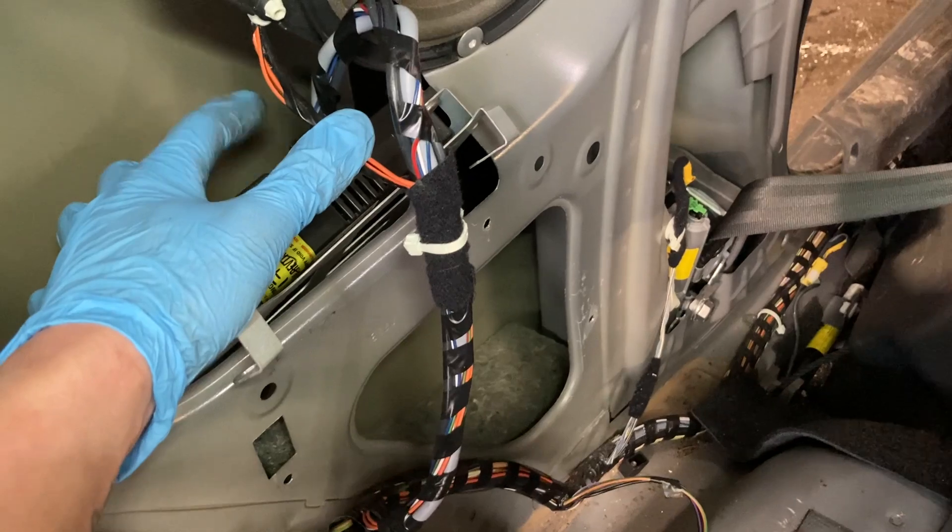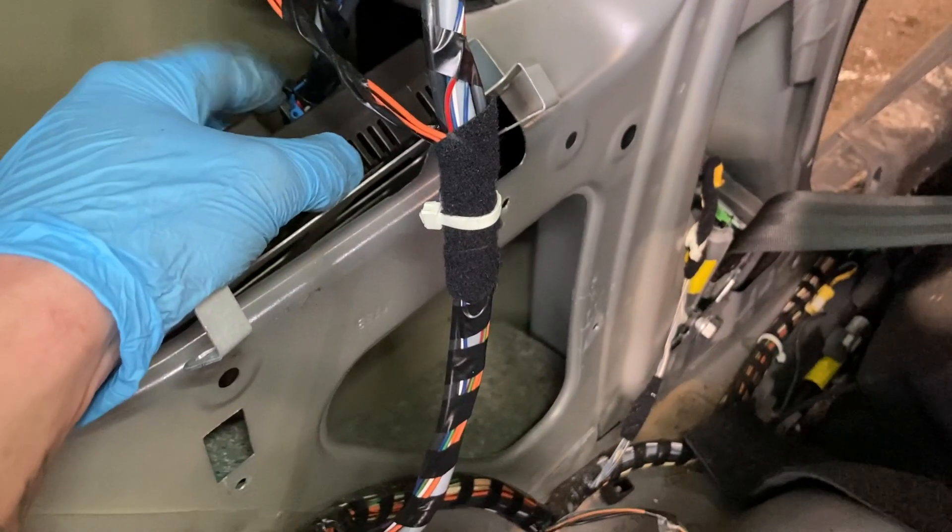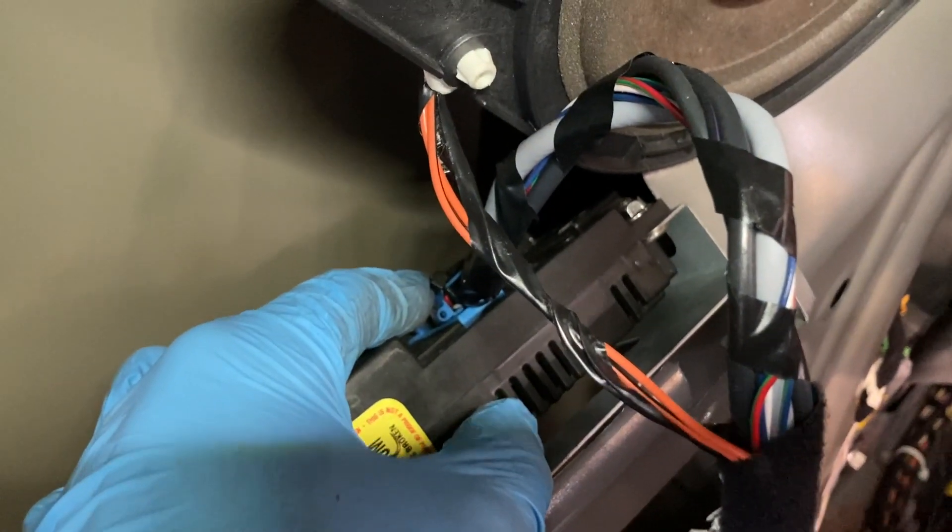Just before I box this up and do a quick alignment, I want to show people trying to remove the module themselves. This is the connector for the Blue and Me module. I really struggled getting it out because I tried to take the loom out first. You'd be better off disconnecting the battery and hitting those rivets out first to give yourself some room to work with. If you want to do the wiring side first, it's this black lip here — not the cable tie, the thing behind it. Just gently prise that up with a flat head, it'll pop and unlock the loom. In hindsight, I should have done the rivets first. Disconnect the battery, take off the earth terminal, hit those rivets, give yourself room, then bring up the Blue and Me module, pop that tag out, and pull out the connector.